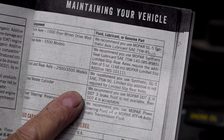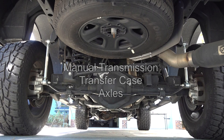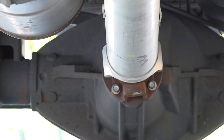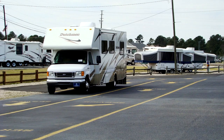Only use the manufacturer's recommended brake fluid. The fluid levels in manual transmissions, transfer cases, and axles need to be checked periodically too. Seals can go bad and start leaking gear oil. One quick way to identify a leak under the vehicle is by looking for signs of oil in the area where the vehicle is usually parked. Other methods are to get under the vehicle and inspect the seals, or take it to a reputable repair facility